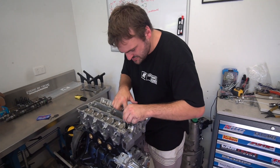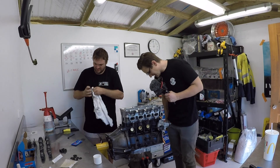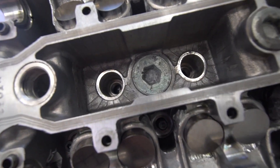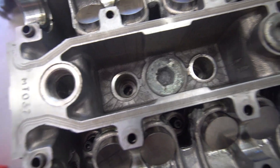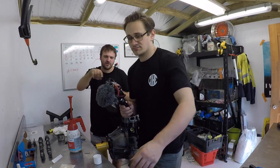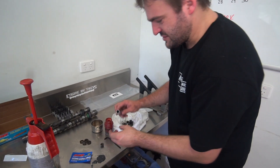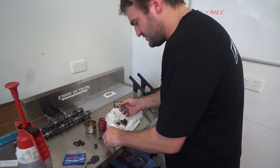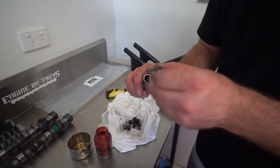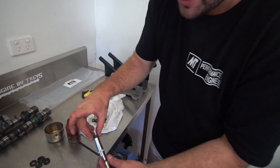It's nice when you can see the piston right at the spark plug hole, right at the top — you can definitely see it. See that red grease there? Here's the trick: when you're trying to put nuts down into that hole, they just fall out. So what I do is get a little bit of grease and line the inside of the socket — that way when you put the nut inside it, she holds it.